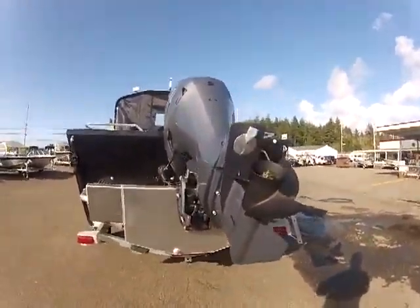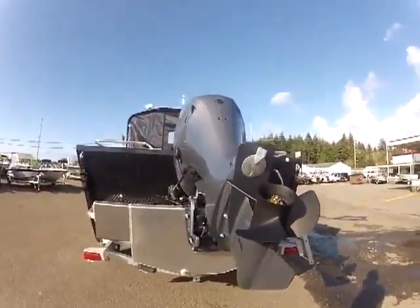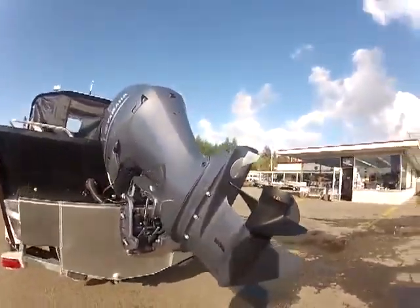I don't know if this is propped right — I'm going to try a 17. On this I might have to change the diameter and the pitch. We'll know when I take it to the water.